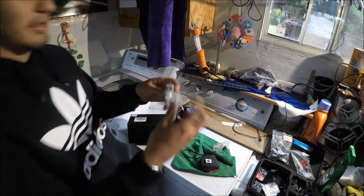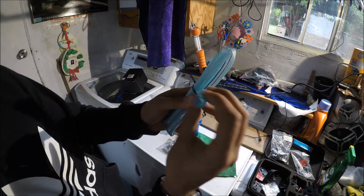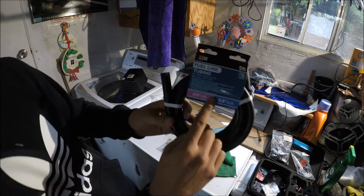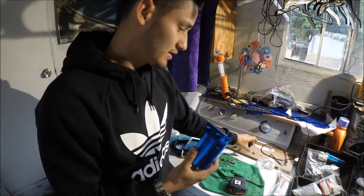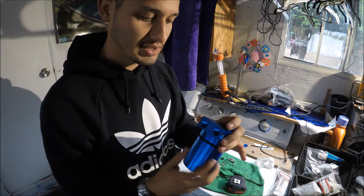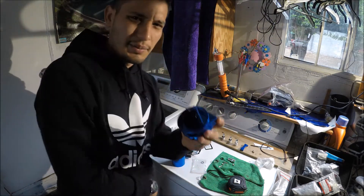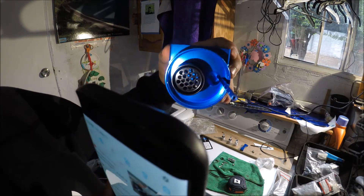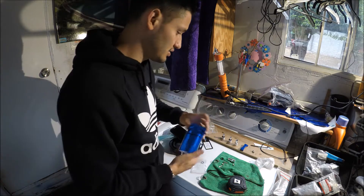It comes with hardware: your fittings and the nipple for it. Normally it also comes with clear hoses, but those are pretty much garbage — they're super thin and won't handle the heat in the engine bay. I went ahead and got fuel line tubing instead, which is recommended because it won't degrade and is actually meant for this application. Once you take off the top with an allen key wrench you can see the inside, and I know some of you want to see how the baffle looks.